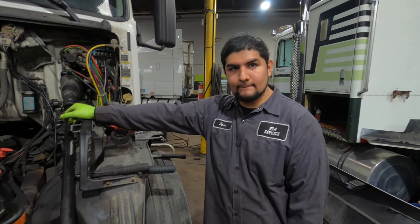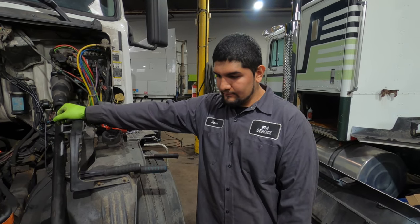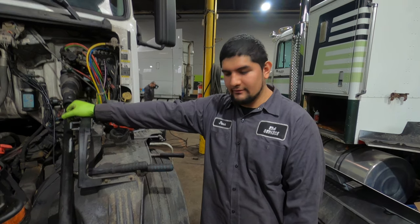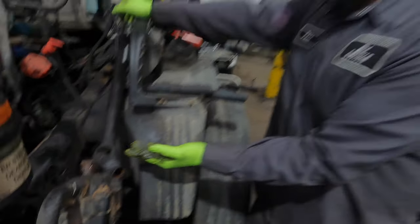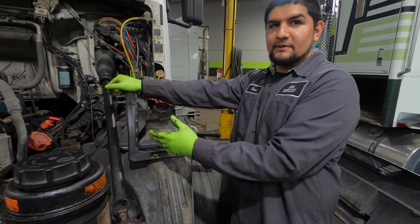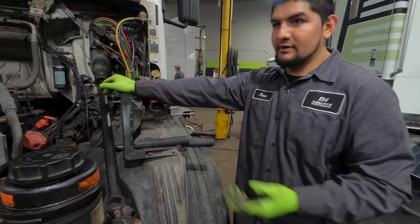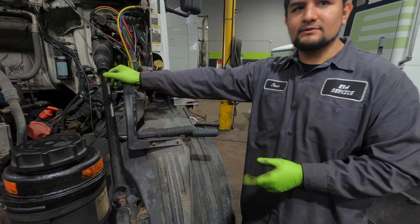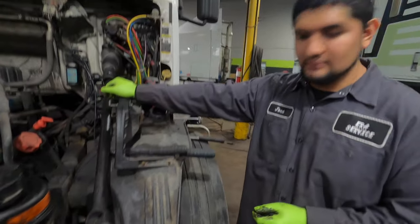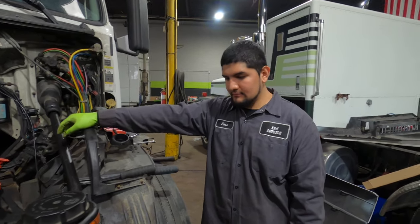It's not too expensive to swap. On some trucks it's around $700–$800, which is still cheap. I would look at swapping it around 750,000 miles. They are serviceable — you can replace just the U-joints. Kenworth U-joints are about $70 each, so $140 for both, plus about two hours of labor. Or you can buy a whole steering shaft for around $250–$275, everything brand new.